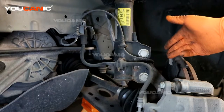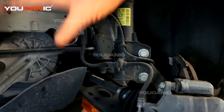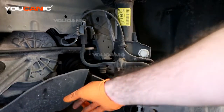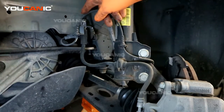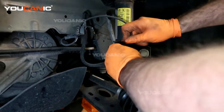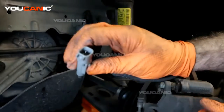To start, you can either remove the sensor side and work your way back up or the other way. Either way, you have a wheel well in here — you may or may not want to remove it completely. The connector is right here, so whether you remove that wheel well or not, follow the sensor line up to the connector and undo it. Pop these grommets out of their holder, then push the tab on the connector and pull the cable undone.